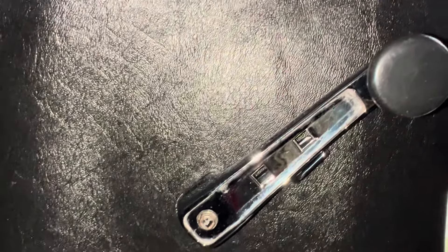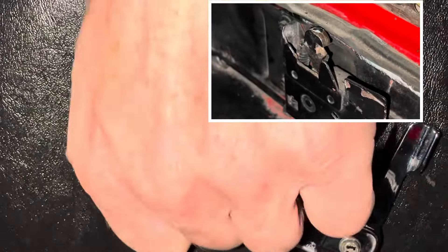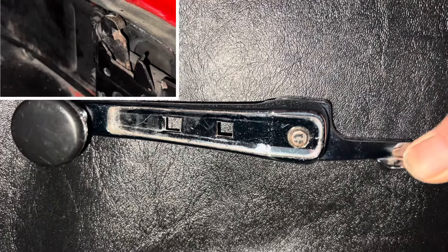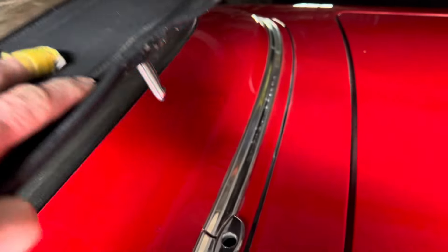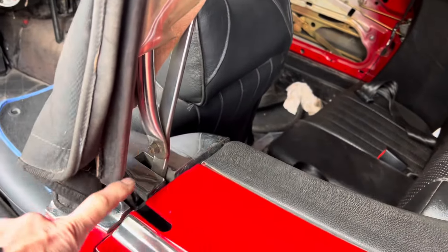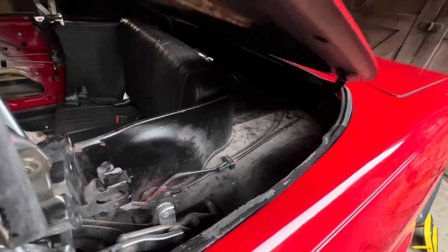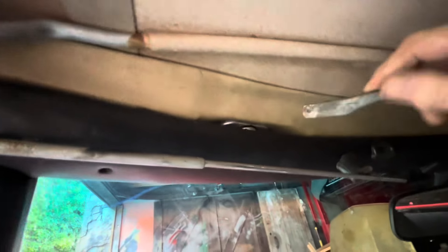When you come to put your soft top back in the compartment or take your hard top off, the first thing to do is push this handle down — that moves the hook up. Once you have the handle in that position, move this lever down and that moves the hook back out of the way. Once you move that hook out of the way, the soft top should spring up like that. Fold it all the way up to the top so that when you open the clamshell it clears this section. To open the clamshell, just push this handle down one click towards the seat and it should spring up. With the clamshell up and the roof folded back, now you can undo these top catches — that's the last thing you do, and once both are undone the roof will just lift up.